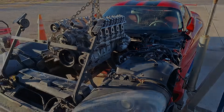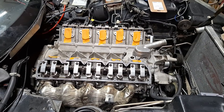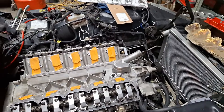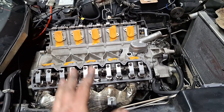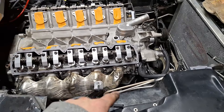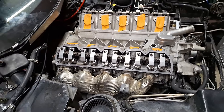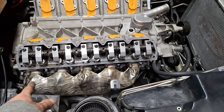Engine's in - that went really smooth. What we did was definitely the right way to do it. For the motor mounts, I took off the pedestals, the ones that hold onto the four bolts on the engine. That made it super easy to maneuver into the transmission, and then we did the motor mounts after that and it just pretty much fell in place. I got back from dinner and put the spark plugs in, put the headers on, put the heat shields in there.